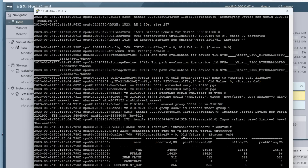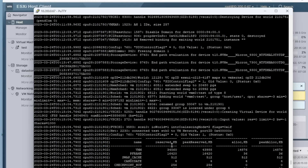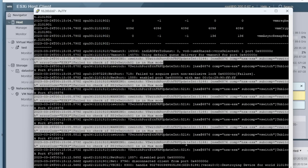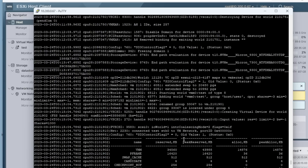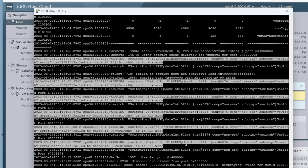If you've never done GPUs or virtual functions, or you're messing around with this on a lab machine or picked one up on eBay, there's still plenty you can learn on older GPUs. You might get a lot of frustrating errors from VMware — won't start, there are problems. Most of the time it's because you forgot to enable Above 4G decoding in BIOS. Sometimes there are advanced parameters you need to set on your virtual machine. If you log in via SSH and search for vmware.log, that's usually the easiest place to check.